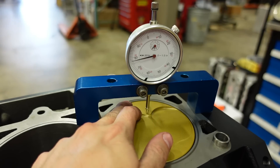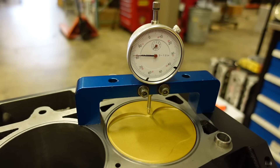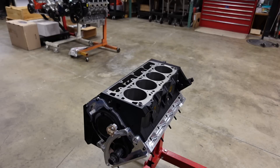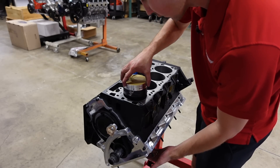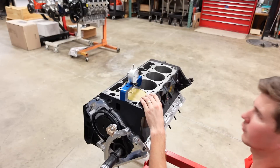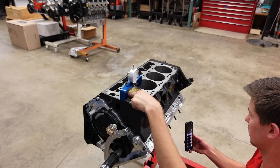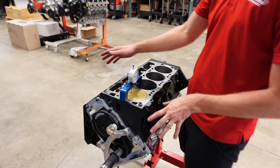We take 14 plus 22 and divide by 2 to find an average of 18 thousandths in the hole. With this combination I'm going to run 75 thou of quench. So we take that 75 thou quench number minus the 18 thousandths deck height clearance, which means I need to order a head gasket that is about 57 thou thick. We'll run back through the exact same process just to triple check that everything is perpendicular and perfectly square on this engine block — rock it one way, write down that number, rock it the other way, divide by 2. This side is exactly the same, as it should be, because this block has been parallel surfaced, so the deck height on all eight holes will be the exact same.